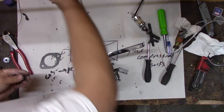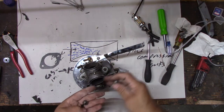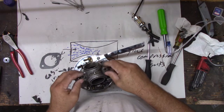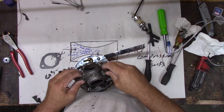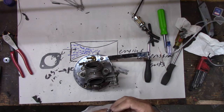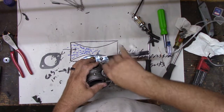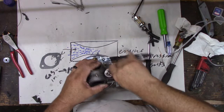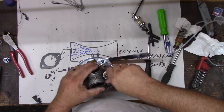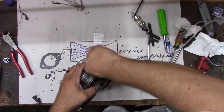All right. And then these washers on it. We might have to take this back off to install it, because sometimes it's easier to install this without the carburetor on it and then install the carburetor. Let's see. I think last time I did it, I installed this breather intake first, and then I put the carburetor on. So we might still have to take this back apart, but we'll just snug it up so we don't lose our parts. And the gasket will be there, right?